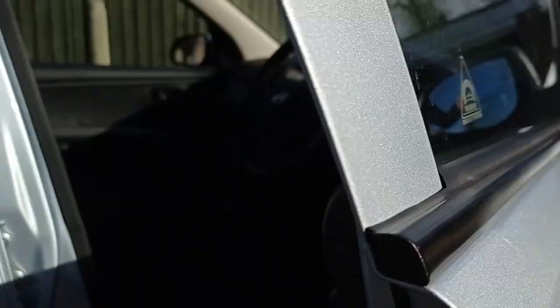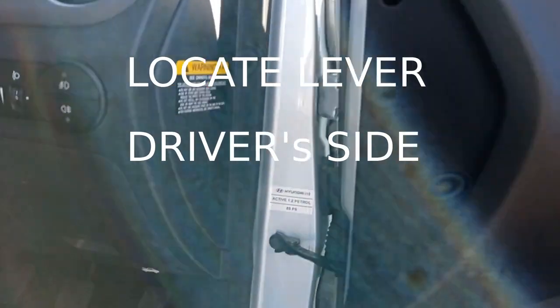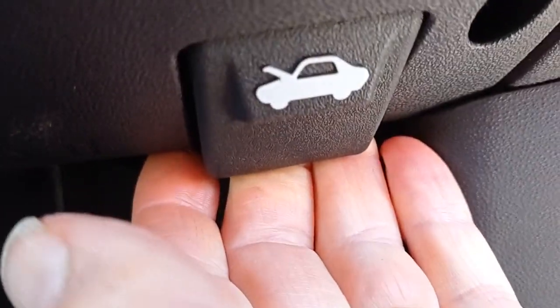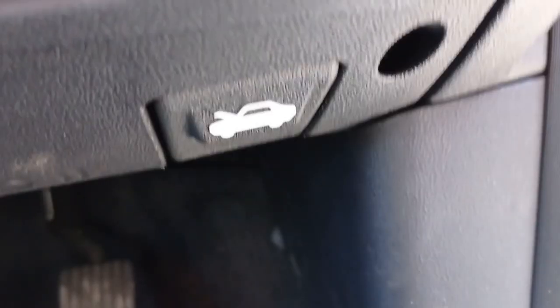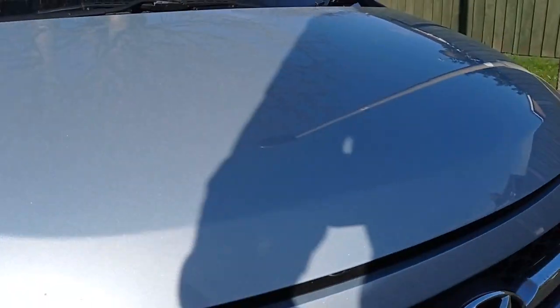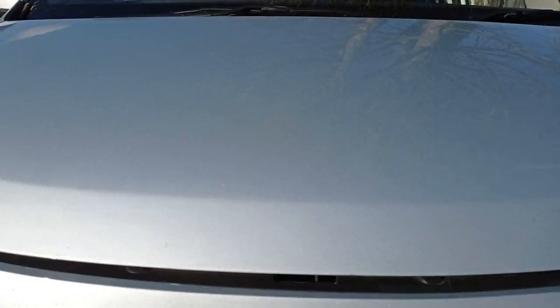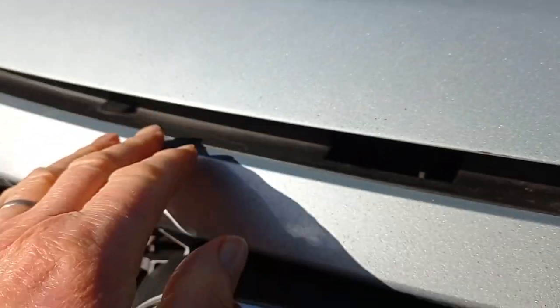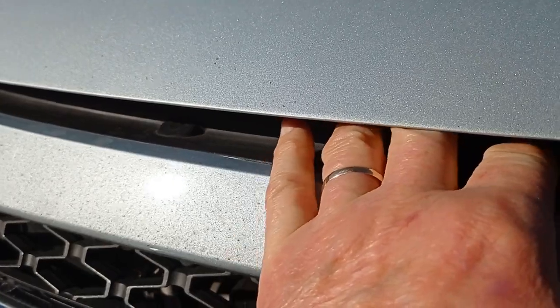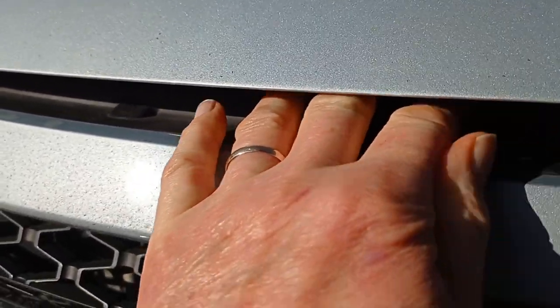The lever is on the driver's side and it's rather well hidden, so put your fingers up the back. There's a very loud click, so you can see you've got a gap there now. That gap's enough to get your fingers in — this is a safety feature. Now I've got to find the lever; it's not attached to the bonnet, it's attached to the car, and my finger is up against it. Just got to pull it off to the left and lift at the same time.